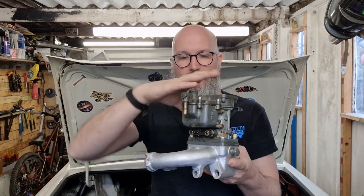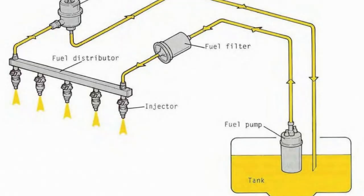The fuel delivery also needs to change. Currently I have a small pump near the tank delivering fuel to the carb at 4 psi, where it sits in a float bowl. An injection system uses a fuel rail connecting all injectors, pumping at 20-30 psi minimum. Unlike a carb, fuel doesn't stay in the rail — it continuously loops back to the tank. I need a return line and a swirl pot or collector in the tank so the pump always has fuel available, especially under hard cornering.